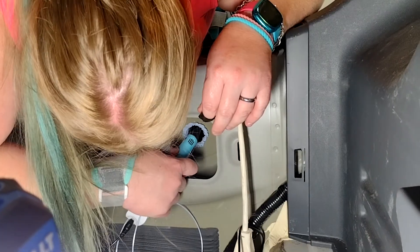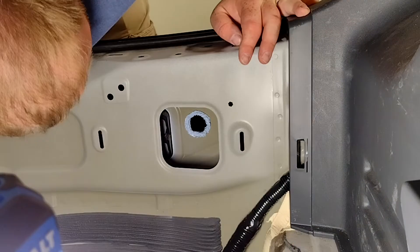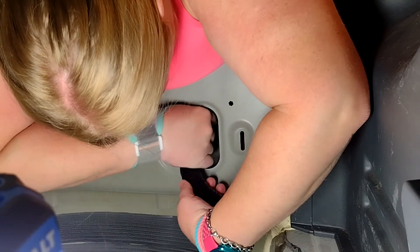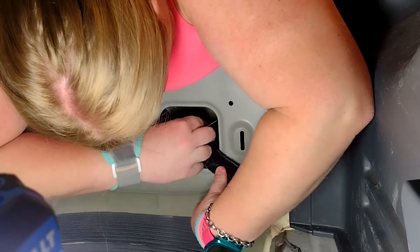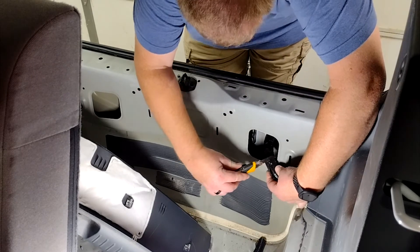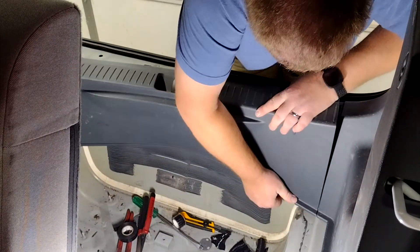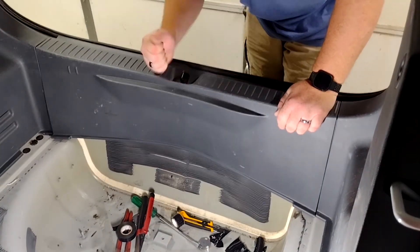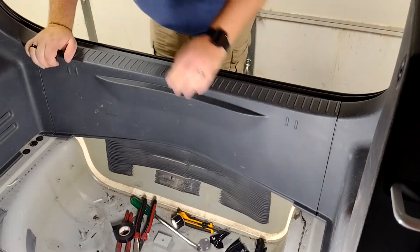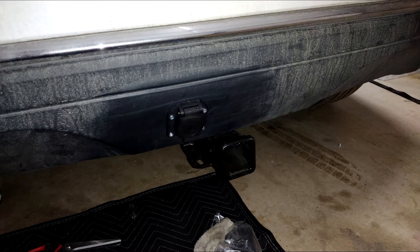Once we were done, we made sure to give it the old wiggle test — not coming out. With a bit of finesse, the connector fit through first and the loom followed almost perfectly. I did have to trim a bit of girth from the wiring for the last panel to snap back into place. I originally zip-tied the connector here, but I really didn't feel comfortable with that, so I ended up converting to a 7-pin and installing it through the bumper instead.